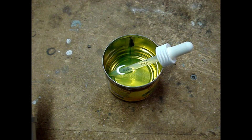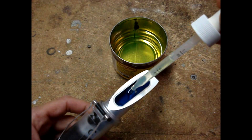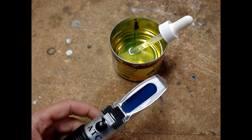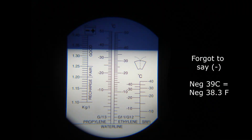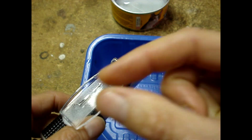I'll test the 50-50 mix. Wait 30 seconds after you put a sample on the prism before you check the eyepiece. The reading is about 39 degrees Celsius below zero — that converts to about negative 38.2 degrees Fahrenheit. That's pretty good for a 50-50 mix; the container says negative 34 degrees Fahrenheit, and I wasn't super precise in my mix, and it was a small sample.